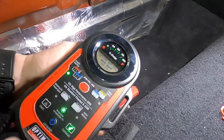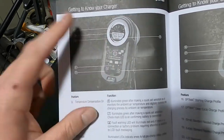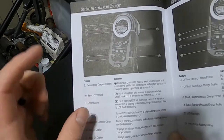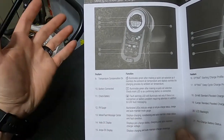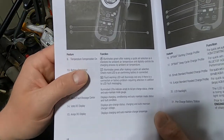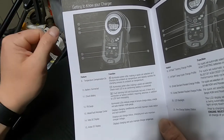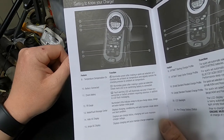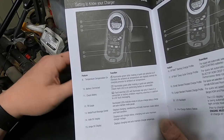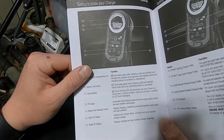With the chrome ring around it, it's really hard to read. On the unit, the top portion of the display shows charging, conditioning, and auto-maintain mode status — as well as any fault conditions. So if you plug it in it will analyze the battery, display any faults, show when the battery is charging, and then once it's done it will say it's maintaining. To the lower left where it says volts, it displays pre-charged status, and then charging and auto-maintaining charger voltage. The amps section displays the charging and auto-maintain charger amperage.